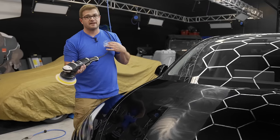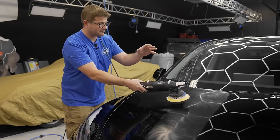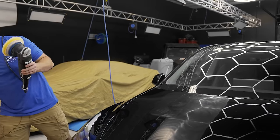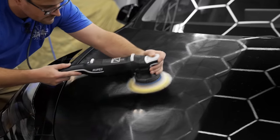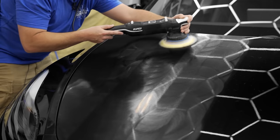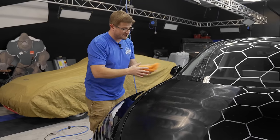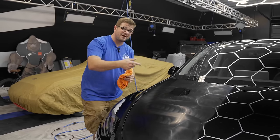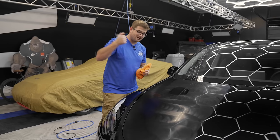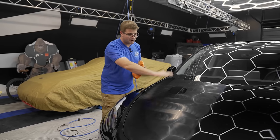I cut it right there because I could feel just a little bit of pad grab, meaning even though the pad is primed I want to add a little more Uno Protect. From here I'll apply a little bit more to my pad, and that will get me enough to knock out the entire side of this hood. After making my pass, I take a quick look to see what kind of correction I got. I can see a little bit of the surrounding edge from that water spot, but it's nowhere near as bad as it was. I can either make another pass or, since I'm being paid to enhance gloss and slickness in one step, call it good and move on.